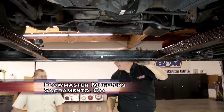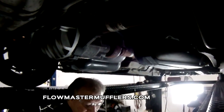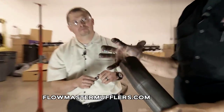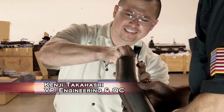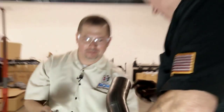Okay, Kenji, I got that in there. So now we get the pipe on there. Hey, welcome back to Motorhead Garage. I got Kenji Takahashi here that's going to give me a little bit of a hand on this. You know, once you get the old system down, putting the new one isn't too bad of a problem. One of the things you might want to do, though, is put a little anti-seize on here, around here. It helps these things slide together. It's a lifesaver, isn't it? Yeah, it sure is. I know Sam loves it. He uses a lot of it. That's good. We'll put that around here.